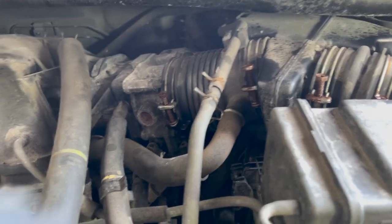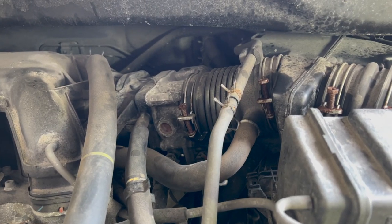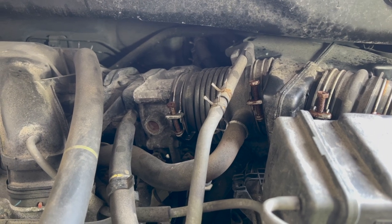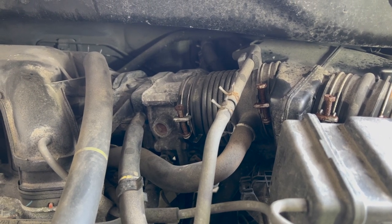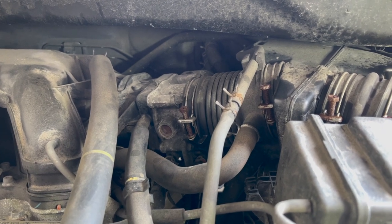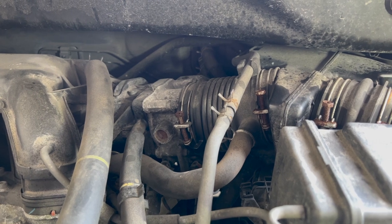There are also two connections for your coolant. In the wintertime, so the throttle plate doesn't freeze in place, coolant runs through it to warm up the throttle plate and make sure it doesn't get stuck.